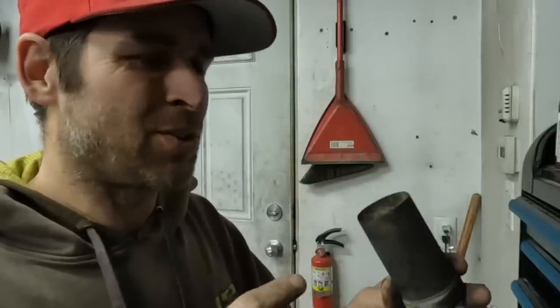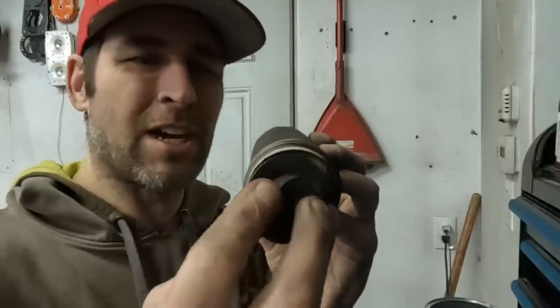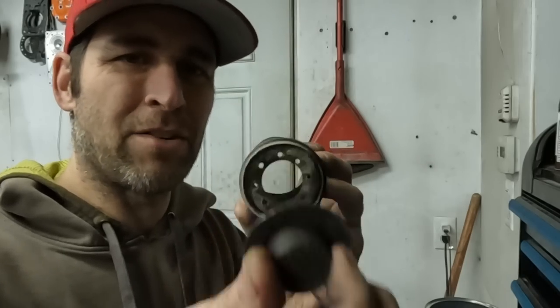My predictions are that there is going to be too much restriction as is. The hole is this big and the catalytic converter is almost exactly the same size — a little bit under that size — and my predictions are that there is going to be too much restriction and that it actually might not fire up. If it does fire up, it's not going to be very happy. But we're going to give it a try this way because it's easier to test it this way and then put holes in it after, rather than put holes in it and then plug those holes up.